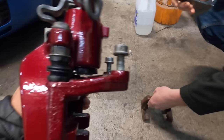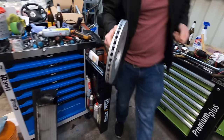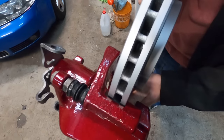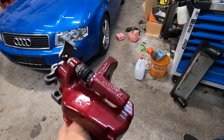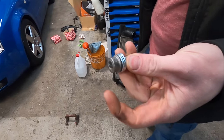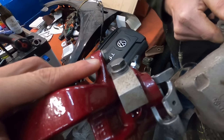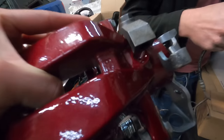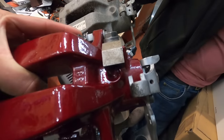We're testing with some washers to see how it sits. The spacer from ECS Tuning is 5.5 millimeters; on Vortex they're saying it should be closer to 6 millimeters. The washers Martin has measure 5.8mm — so maybe one more or one less to get it perfectly centered. Looking at the Anniversary caliper versus the four-motion one — it is different but I could potentially just remove that bracket piece and screw it directly to the caliper. The e-brake setup looks the same; the bracket orientation just goes a different direction.